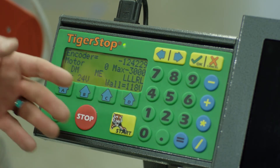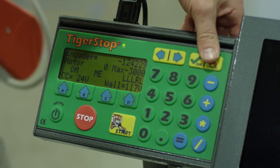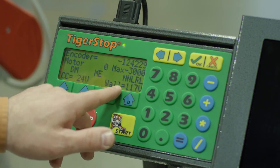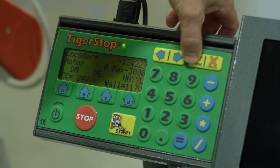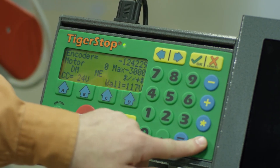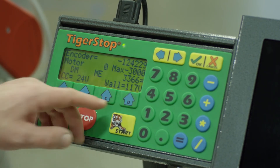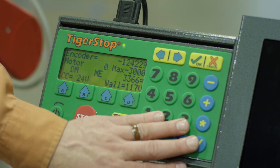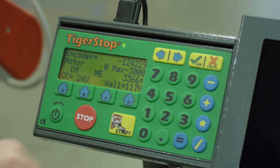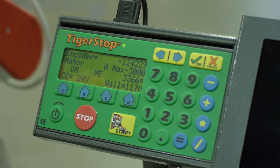The last thing we'll go through is testing each of the buttons on the control pad. Usually start at the top right corner, press them twice — for cancel you're seeing an N, for OK you're getting a Y — and then run down the whole list to make sure each button shows up. Sometimes you'll see buttons randomly pop up on the third line, which means you may have a sticky button. If a character shows up on the right side of the third line without any input, that may mean a button is sticking on the keypad and may need to be replaced.